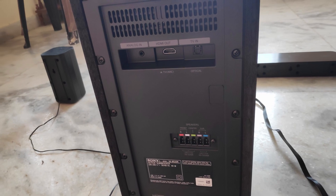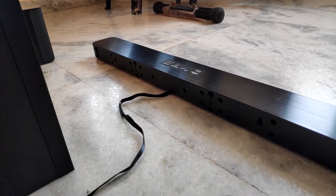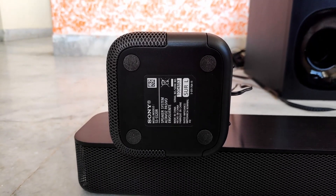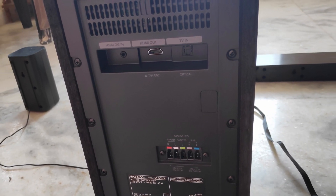The connectivity is very versatile. HDMI ARC is very useful and provides very good audio without any compression. If you have a TV which is HDMI ARC compatible, I suggest you use it for very good sound output. You can also use a 3.5mm jack if you have an older TV or want to connect a phone. If your TV supports optical audio, you can connect with that as well. Additionally, Bluetooth connectivity is supported — if your TV has Bluetooth output, or any Bluetooth device, you can connect and stream music to this device.